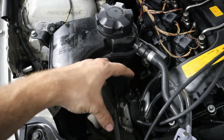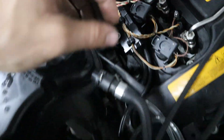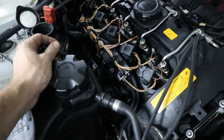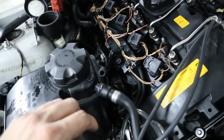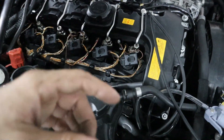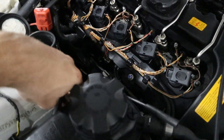So the first thing I did was I pulled off the lines. There should be some vacuum canisters right here. These go directly into the solenoids after the expansion tank, and that's going to be these adapters right here. What I did was I hooked up a tester to the solenoid and opened and closed it while sucking on this tube here. It's a little manual of a test, but I was able to determine that the solenoids were both working.